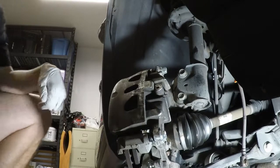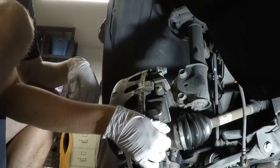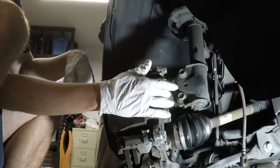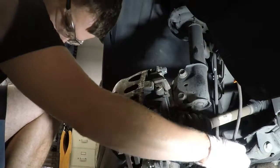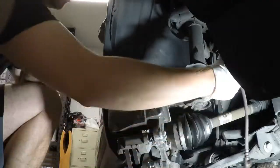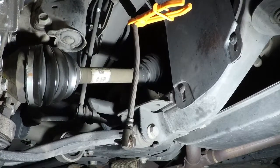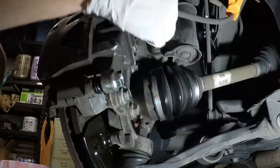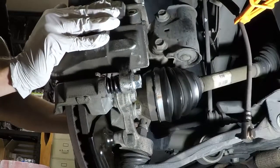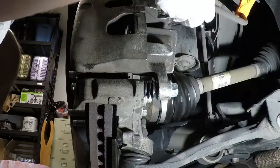So the next piece we're going to do, now that we've got the bolts mounted and the guide pins torqued down to 55 pounds, is the banjo clip, which is the brake line for the banjo bolt, for the front. You can see I still have the actual hose hanging off to the side, with a little pincher still on it right there. Basically we're just going to reconnect the banjo bolt and then torque it down to 35 pounds. So bring that around, and to make it easier, I'll rotate it as well. Remember, the caliper is still loose in there because we haven't pushed any brake fluid through it, so the pistons are still retracted.